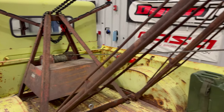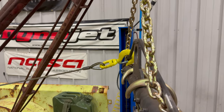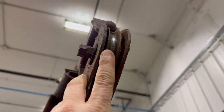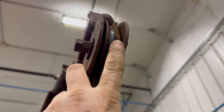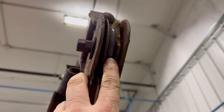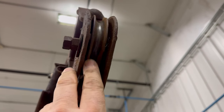The winch is all wound up but it's a little hard to keep tension on it at the moment — I have it connected here because I need to do a little work up here first. The old sheave in this thing is not in very good shape. You can see a big chunk missing right there, so I'm going to take this out and replace it. I'm also going to replace the pin — you can see how wobbly that is. This is in dire need of a new sheave and pin.